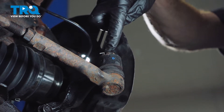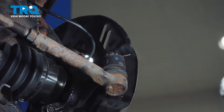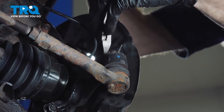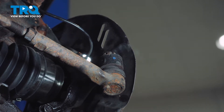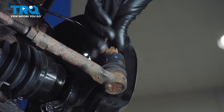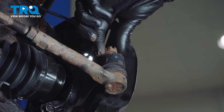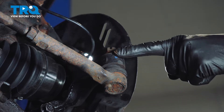Now let's make our way along the front of the knuckle. In this area, you're going to find your tie rod end going through the knuckle. We will have to remove the locking cotter pin and then remove the mounting nut so we can break this free. We'll use a 19mm to remove this nut and then start it back on just a couple of threads. To break the tie rod end free from the knuckle, you can just give the knuckle itself a couple of loving bonks with a hammer — this will cause vibration and the tie rod should come down.